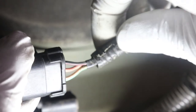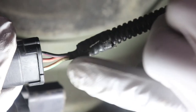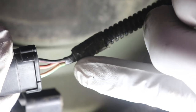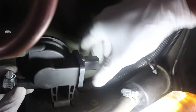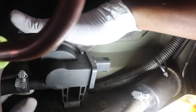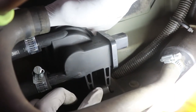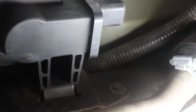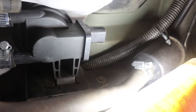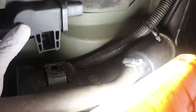Here's a better look at the wires: black with purple is your ground on the far right, orange in the center is your switch to start, and white with green wire is your main power source. If you reach up top — you can see it from the bottom on the 2003 Ram 1500 — there's a little clip tab between the metal bracket and the leak detection pump itself. Push it towards the leak detection pump and slide it up. It's that simple.